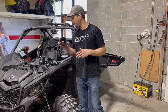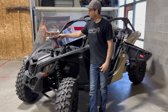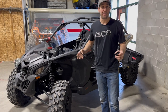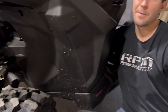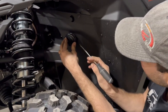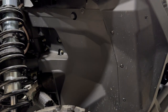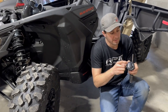Pick these up at rpmsxs.com and let's install one. Moving on to the install — it's super simple. A two and three-eighths hole saw drill bit and a flathead screwdriver, that's all you need. To find out where to put it on this universal kit, you want to make sure you don't drill into anything behind the firewall. On these X3s I've installed a few already — I reach back up in here making sure everything is clear. I know I'm aiming for this area, everything behind this is clear, so I'm marking about here — I want to be right about there.